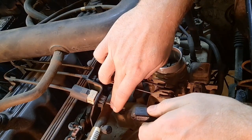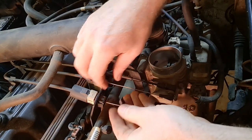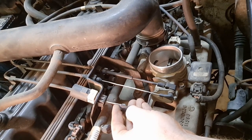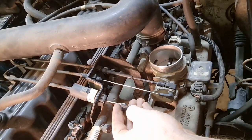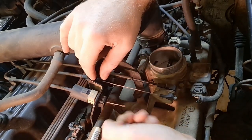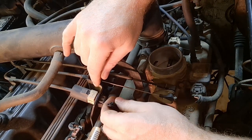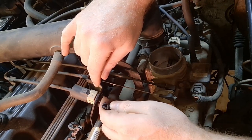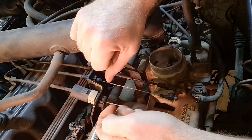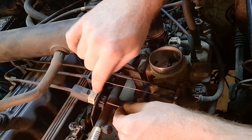To fix this, what you'll need to do first is take the original connector that was on the cable and essentially just take some large pliers and crush it — you can see here how we've kind of crushed it. Be careful: you don't want to cut the cable or damage it in any way, but you should be able to crush it and break it up into pieces. Maybe use two pliers to pull it apart until you get the cable cleaned up.